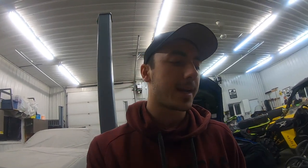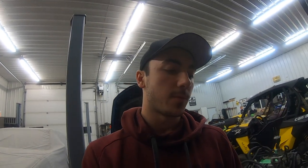For my fuel pump, I'm going to be running the AEM 340 liter per hour fuel pump. It's E85 compatible too if I ever want to switch over. Also going to be running the ETS rotated turbo kit paired up with a Garrett GTX3576R. So yes, we're going to be running a big turbo on this guy.